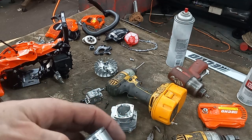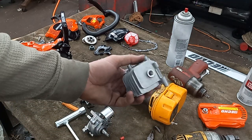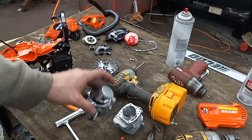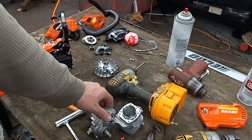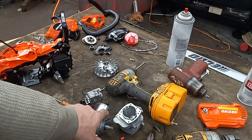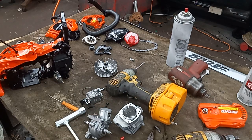But I just thought I'd, you know, show you, if you want a little more economy, don't do the piston mods. You can do everything else, like that Panther kit one that I did. I did all this stuff except for I was 105 on the exhaust on that one, and I didn't do the piston mods. The other one that you guys seen pull the 24-inch bar, which I don't recommend. That was very hard on my clutch. I was just testing, see what she had. That one's done up like this, except for I don't think I lightened the piston, whereas I lightened this one on the inside. But I'm always dibbling and dabbling and trying different stuff.